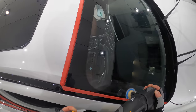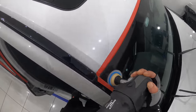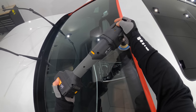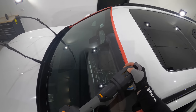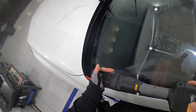The main reason I use specific glass or windscreen coatings on the front, rear, and side glass is that paint coatings tend to more often lead to wiper chatter and even more wear on the side glass as the windows rub up against the rubber seals when they go up and down. If it wasn't for these issues, paint coatings would actually work just as well on all the vehicle's glass.